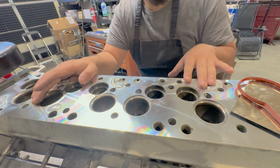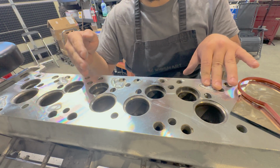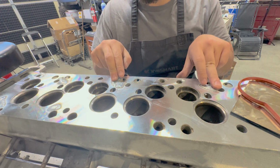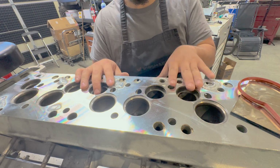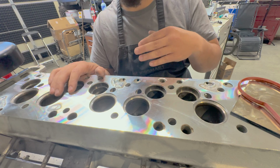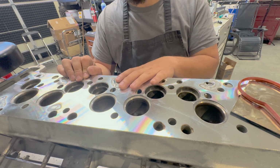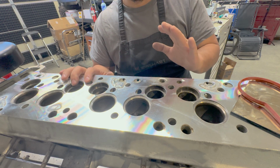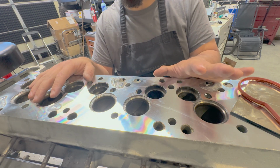what I discovered was there were a few bits of porosity all throughout the welds, just along the edge of the weld. The material I put in had been pretty decent, overall pretty clean. But I knew that I needed to come in and do some touch-up. Well, I started doing that, and it was the same situation. I started cooking out more crap, and it's really just a problem with the casting. It's a dirty pour. You're going to sit there and fight and fight and fight and just heat soak the part if you want to get it perfect.